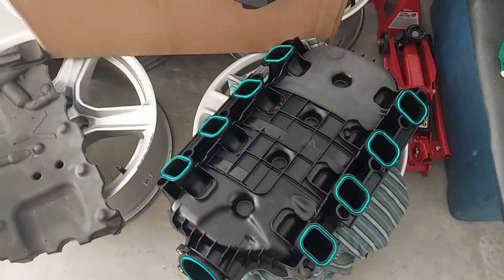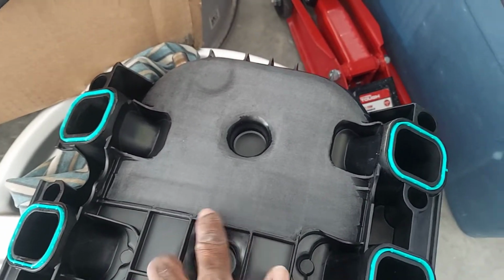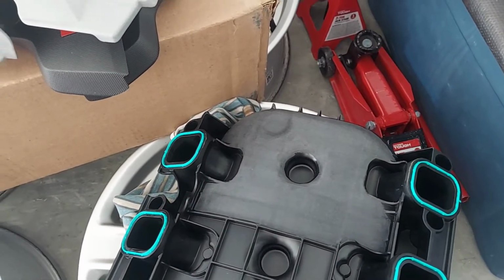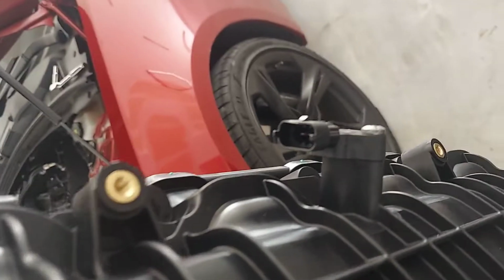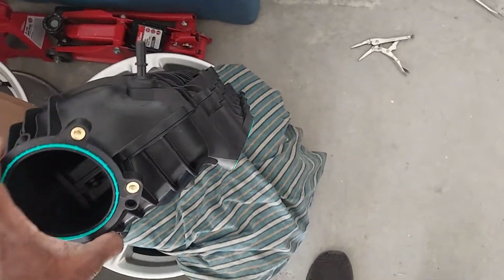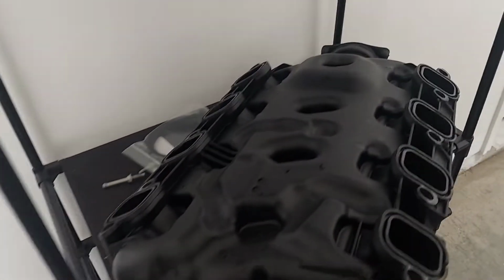And then here's the LT2. Gaskets in the bottom, gasket on throttle body. See, GPI shaves this also to fit, because just buying one from the dealership and trying to slap it on is not gonna work. You gotta shave it down in the back to fit. You need the brake booster line in the back. You're gonna need that extension so you can do your MAP math. But yeah, it's a lot taller, the LT2 versus the LT1.